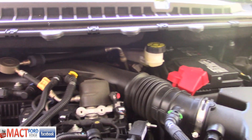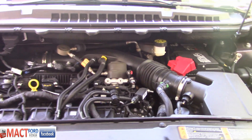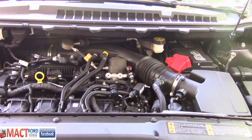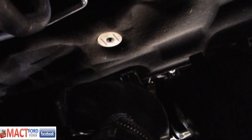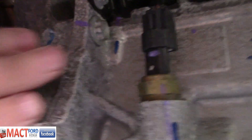On top of that, we also have some other items to worry about — some issues down below. Let's go take a look. Now I don't think you can see it real good, but as you can see, we also have to worry about the turbo, because the turbo is actually cooled and that does create some other cooling plumbing going through there. With your turbo in there, you have to make sure you don't have air pockets in there. This is hard to film getting in there because it's very, very tight. But the PTU right here — mine I don't believe has cooling on it.